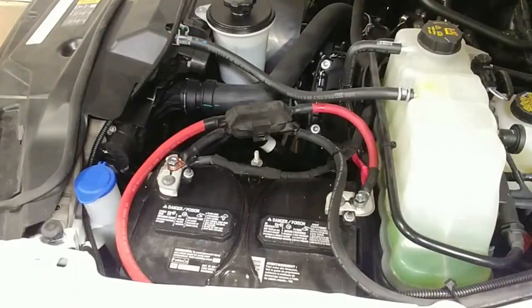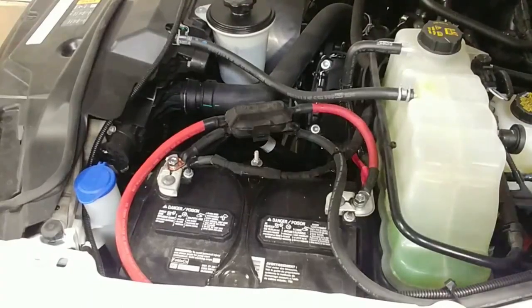I'll start off showing you underneath the hood. Here on the driver's side battery, we've got some number one copper power and ground. We've got a 250 amp slow burn fuse. Those are tied into the power and ground here on this battery and they're running over to the toolbox. So this is the beginning of that special item.